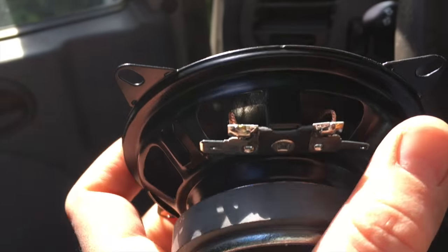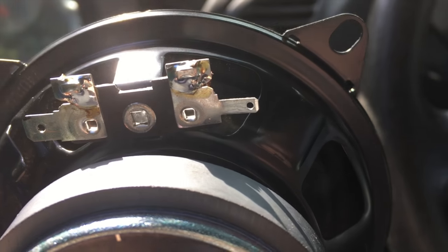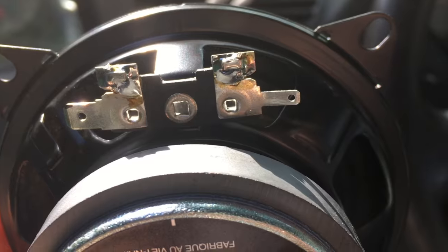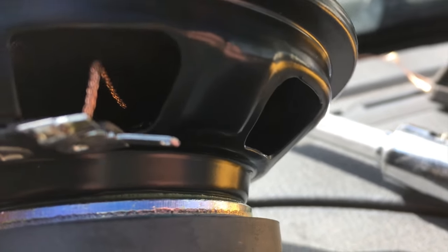The speakers I got were from Pioneer, and I will link in the description to the ones I used, so if you want to do this yourself, it's there. It's just a matter of connecting two wires to the ports on the side of the speaker. Right here there are these two little tabs — this one's wider than that one. The two wires come with connectors. The wide one goes to there and the skinny one goes to there. I basically had to just crimp these down — they don't fit snugly, so I just took a pair of pliers and crunched down the ends of the wires so that they'd go over it.